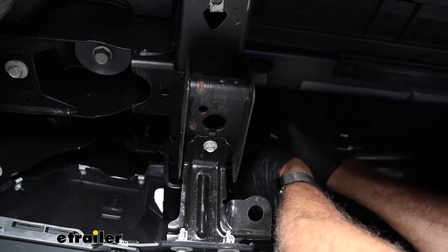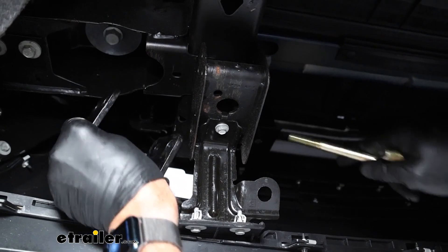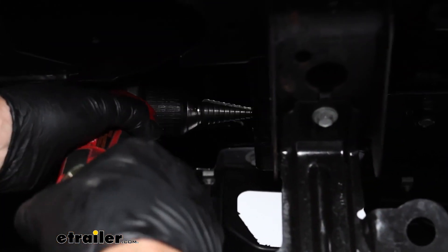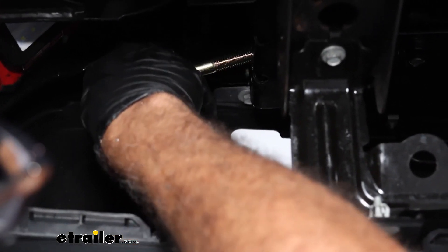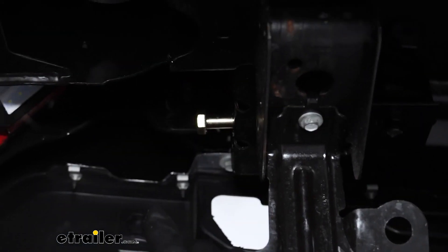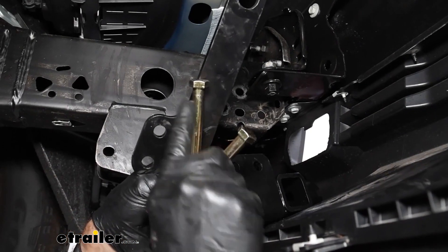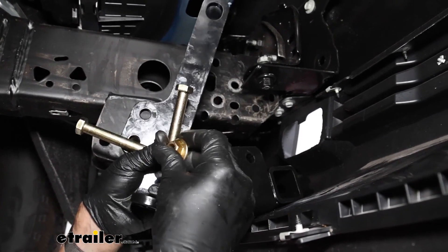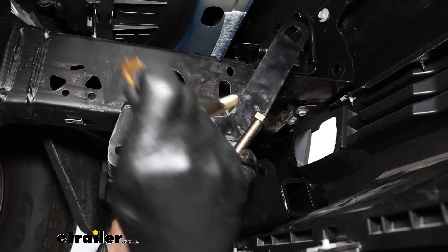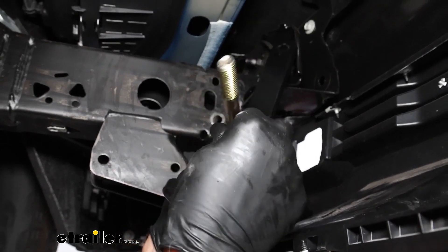Now that the pilot hole has marked the frame, we're going to remove this base plate, get it out of our way, and get this hole drilled. We can test fit the bolt — that's going to work for us. This isn't the only way to do this but it's probably going to be the best way in the Chevy — there's just not a whole lot of working room. You're going to get two of these big hex bolts. You're also going to get some locking flange nuts, and the washers you get have teeth on one side. The teeth of the washers need to go towards the threads on the bolts, so make sure you put the smooth side against the head and the teeth towards the threads.